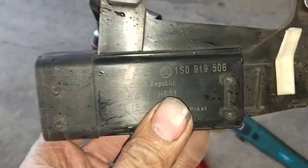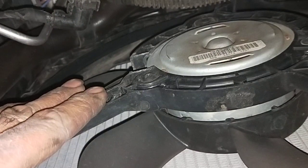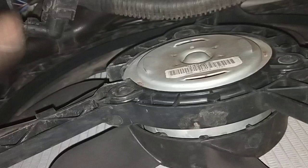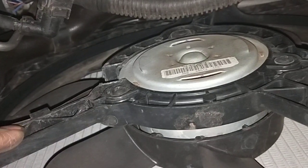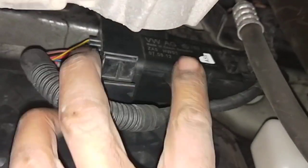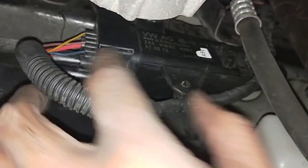The fan was always staying on all the time — I'll show you where it is. So this is the fan; it was always on and the battery was always flat, just keep draining the battery until it's flat and you'd charge it again in that cycle. But this is the actual ECU there — that's a second-hand one that I fitted. Now the fan doesn't run anymore.